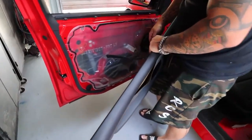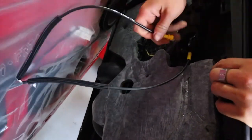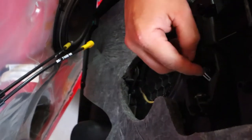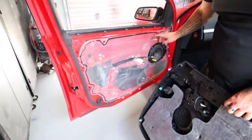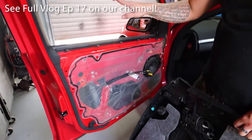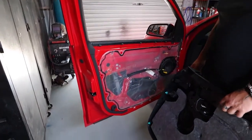And then you get to go in behind here, flick that off and slide it out. There are these little grooves here where the cables come out, and then the door trim's off. From there you can pull this panel off and you can unbolt your window rig, which you do with the window up, crack down just a touch. Or you can undo these screws and flick out your door actuator and replace the door actuator.